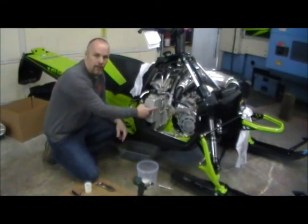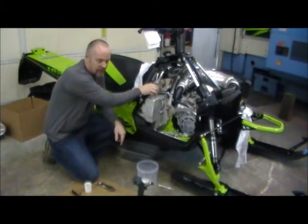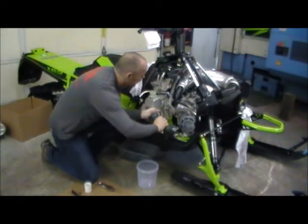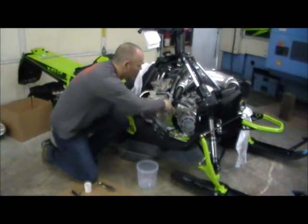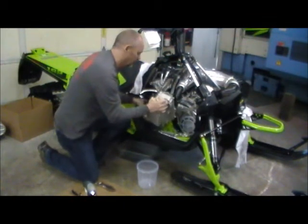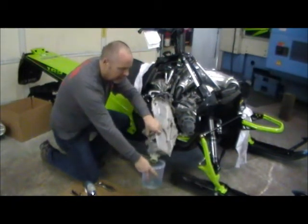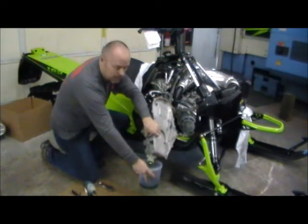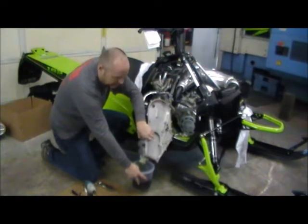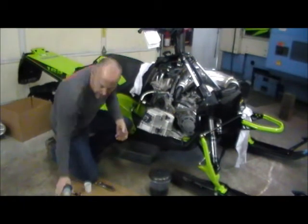So what we're going to do now is remove the last screw off the cover. I'll remove the cap here. When we get that out, you can see I've got a container here ready to catch the oil. It's not easy to get all the oil out, so once you get your oil pump out, because there's some baffles in the tank, you'll have some more oil after that. Put the cap on the tank here so we don't lose any more oil than necessary.